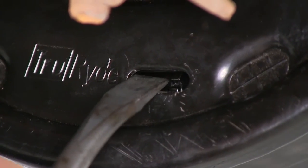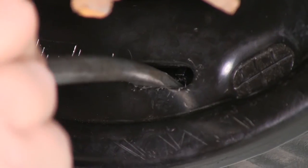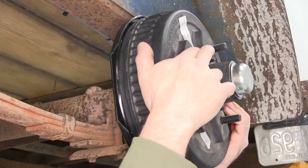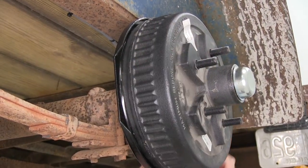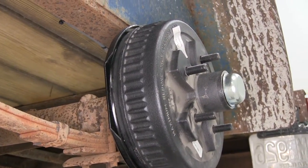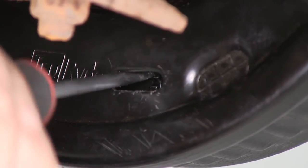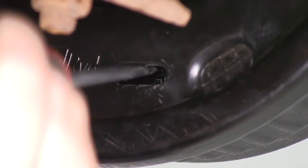As we're turning the brake, we'll go ahead and adjust it so that we stop the brake by adjusting it all the way out. As you can see, the drum doesn't turn anymore because we've got it all the way tightened down here in the back. Now once you have it set at this point, you want to release it or back it off 10 clicks on the little star gear that you tightened up.